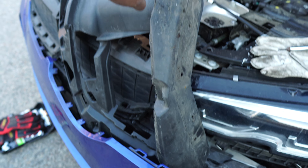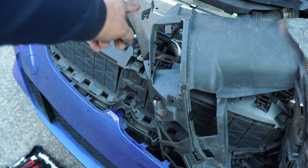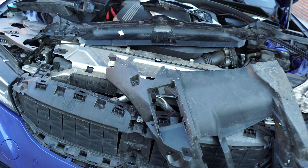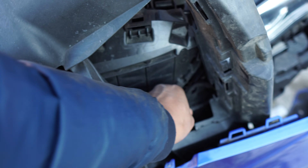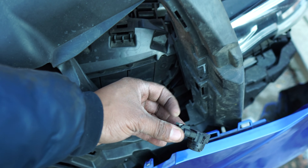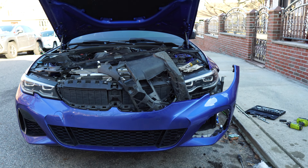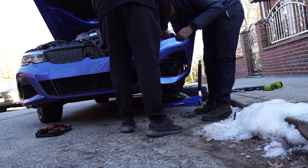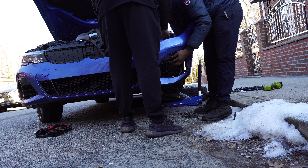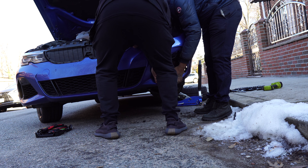Let's walk through what we did first before we clip everything back on. First and foremost, take the wheel off — everything under the shield, all this shielding has to come off. You have two 8 mils right here to pop this off — be careful, don't scratch the inner side. Underneath the bumper you have three of these little tab things — everything has to come off. There's a bunch of different tabs that make it really difficult to remove. Make sure you disconnect the sensor like we did, which is dangling right here — the parking sensors.